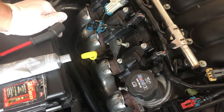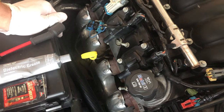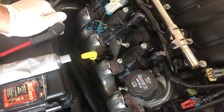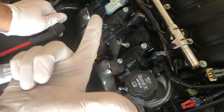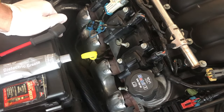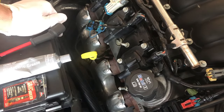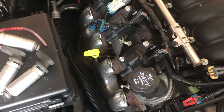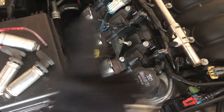These were probably factory spark plug wires that had never been off the car in 15 years — and that's probably going to be the case with your vehicle too. Spark plugs nowadays can go about 100,000 miles before you change them with a factory tune. So: dielectric grease, anti-seize, and mechanics gloves when working around this metal shroud because it is very sharp and will cut you. I hope this helps — make sure you hit subscribe, like, and share this video. Thank you!